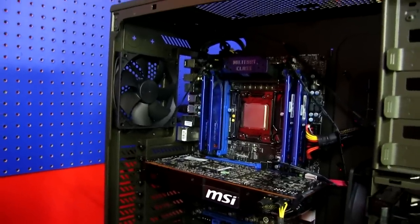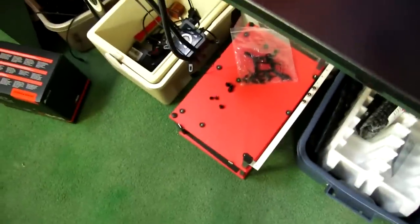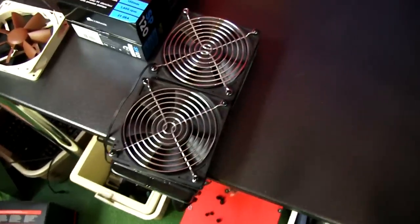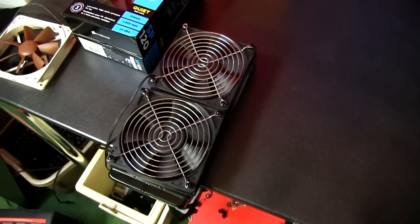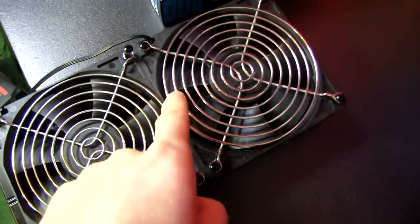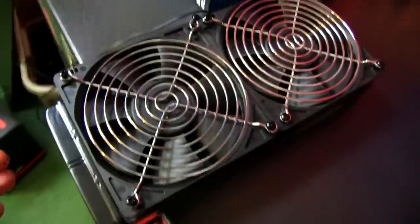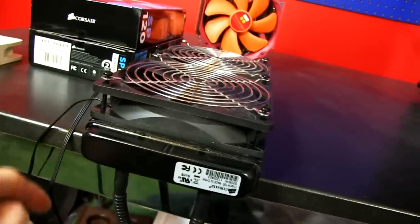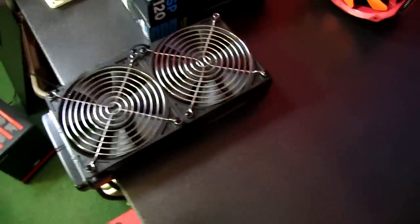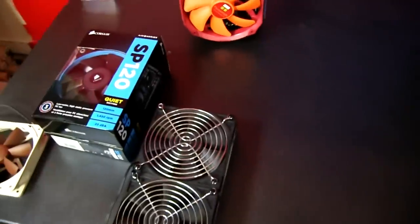The reason I'm setting this up is so that I can do some testing, but while I was working on getting it going, I pulled my H100 off of my test bench and I noticed something I wanted to talk about. I get a lot of questions about should I use my fans in push? You can see this is configured in push — the blades are going to be rotating this way, pushing air through the fins of the radiator, out the other side. Or do I want my fans in pull, which is where you'd flip them around and have them pulling air through the radiator.